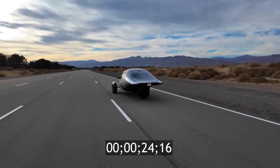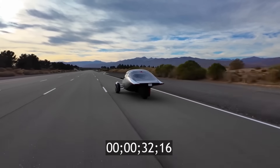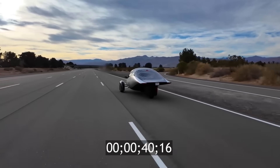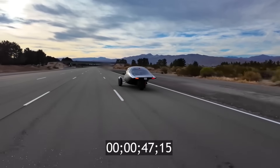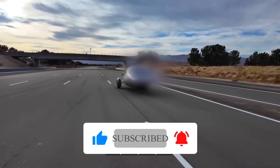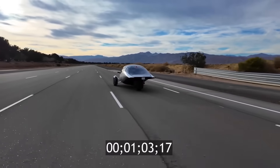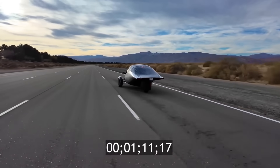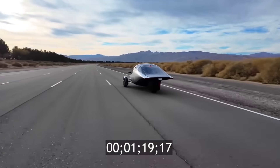The way this works is you get the vehicle and you try to find the flattest road you can. They are on a test track which is pretty flat out in the high desert north of Los Angeles. You want a day when there is as little wind as possible — the most still day is best. Based on the trees and shrubs it looks like this was a pretty calm day with no wind, so pretty good conditions. What's acting on the vehicle: you take it up to a certain speed, put it in neutral, and let it glide. What acts on the vehicle is mechanical resistance, rolling resistance, and aerodynamic drag.